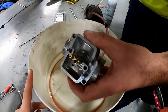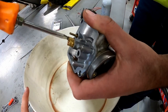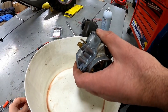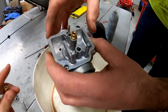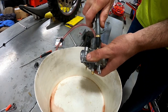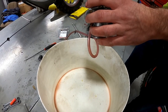Now I can get a regular screwdriver on here — this one might be too big of a head. I want to unscrew this, and again I'll hold this one up to the light. Yeah, just a lot of oil on it. So now I'm going to take my air jazzer and just blow out all these different ports — main jet, needle jet, and then the air screw — so I'll just do this real quick.